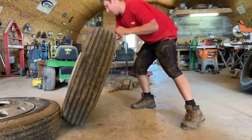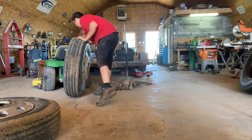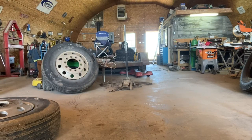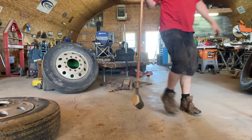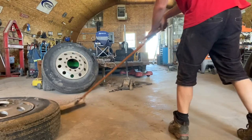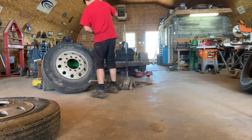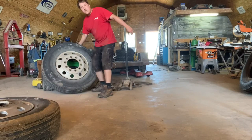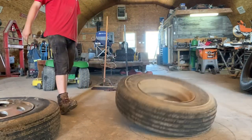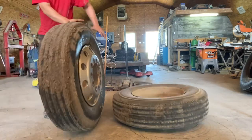And we're gonna flip it up and over. Hang on, I'm gonna sweep that dirt. Because when I flop that dish side down, because these are steer tires, you're gonna see that side. And if there's some rocks and dirt there, it's gonna scratch the face of that rim. I don't like to do that. So when you flop it down, just give it a little spin. Nice and quiet. Not gonna wreck nothing.